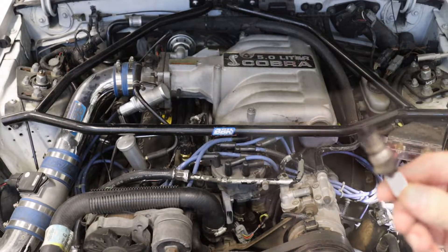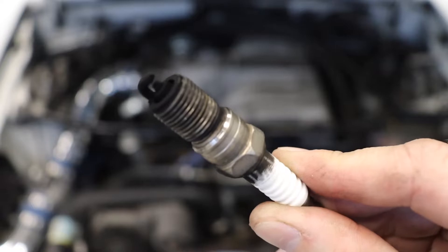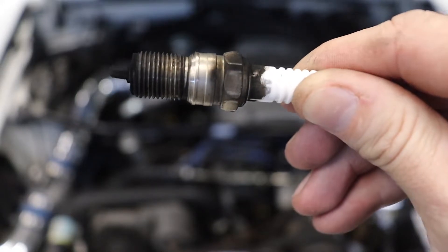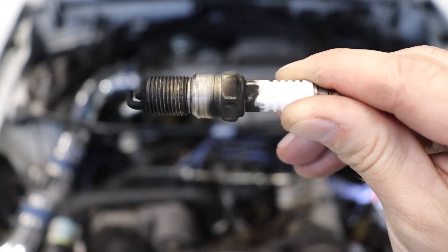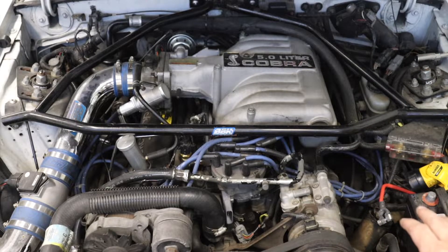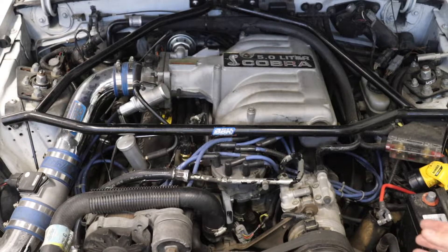Oh, now that's going to be an issue. Can you guess what's going on in this engine? That is spark plug number five — the frontmost on the driver's side of the vehicle. It will be a pretty new plug but look at that condition. Clearly we're running super rich based on that super sooty spark plug — not a good sign. It wasn't wet though, so it's not oil, which I do like. I'd rather see a rich condition versus some kind of internal oil leak with oil pushing past the piston onto the plug. So we're hoping this is just purely a tuning issue.